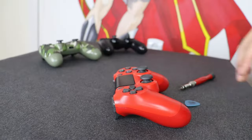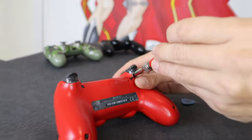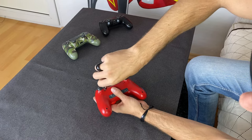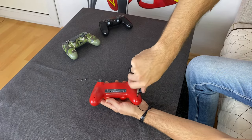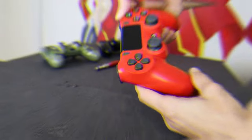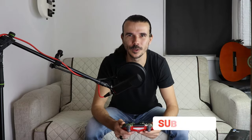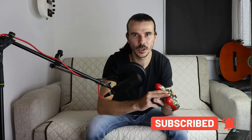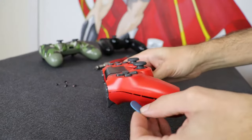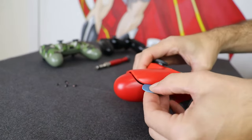Let's begin! I start by removing the four screws on the bottom of the controller using a small Phillips screwdriver. Next I will pop the case open. I found it easier than other methods to twist gently until the lower part of the upper case pops open. There are four clips that hold the controller together — two near the extension port on the front of the controller and one on each side. Be advised that by opening the controller you might end up breaking the side clips.